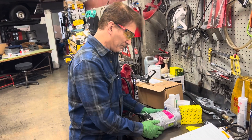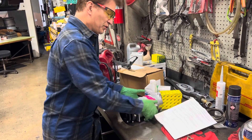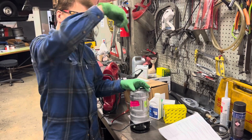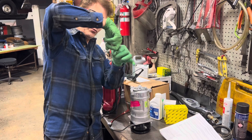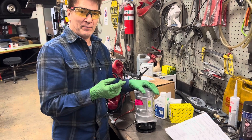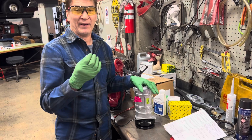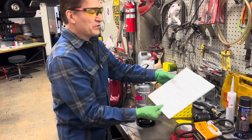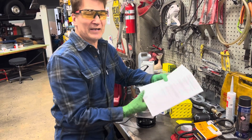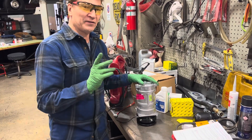We're going to check another thing. With these old shaft seal types, the instructions specifically say to turn the compressor up on its nose on the shaft seal, because you want the lubricant to pour down to the shaft — there's a rubber seal and you want oil on it. Old instructions used to say 15 to 30 minutes, but knowing people's impatience nowadays, they've reduced it to one to three minutes. I like to leave them there for 15 minutes while I'm doing something else.